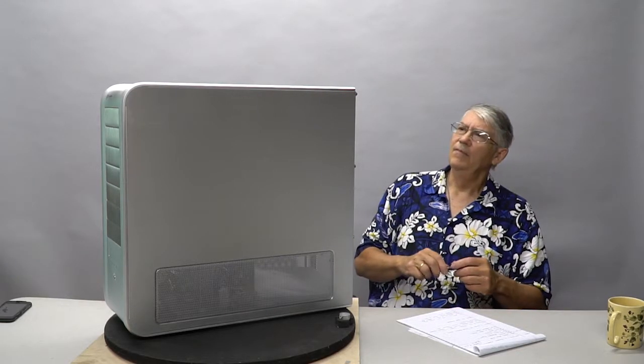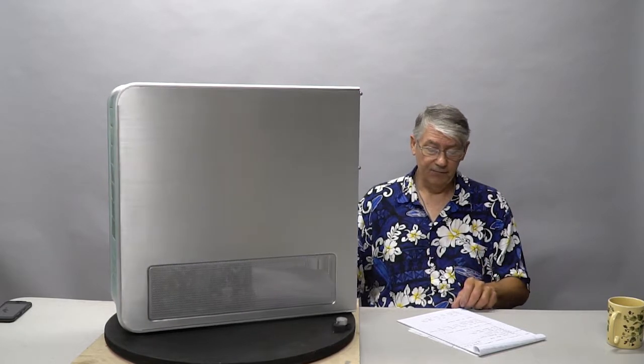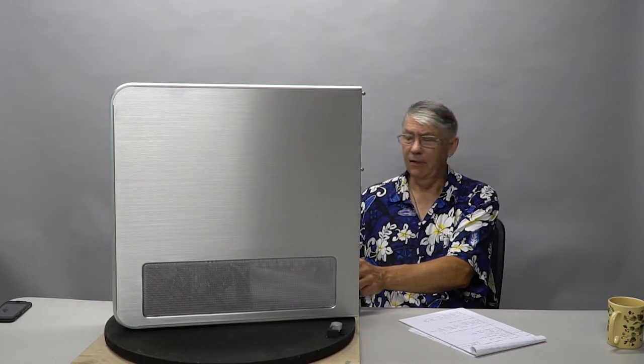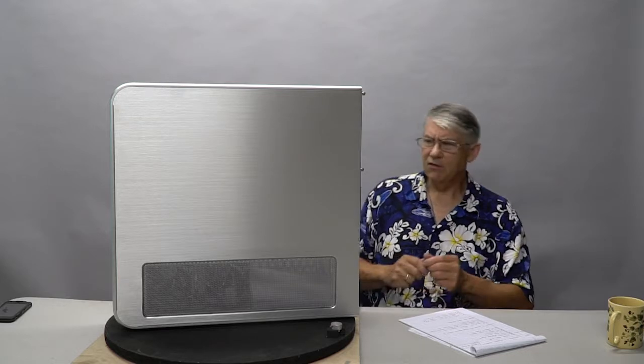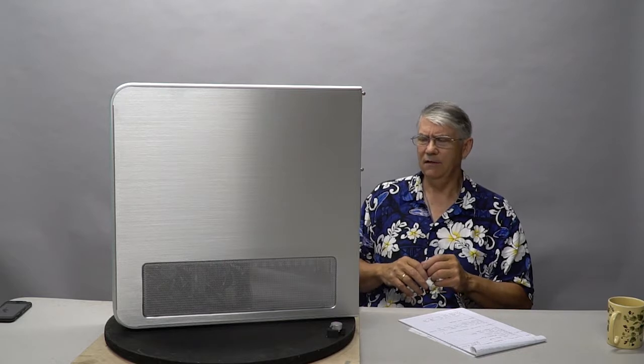And I'm here to talk to you a little bit about this case we're going to use for this build. This build is going to have, and I'll go over all the details of the parts later, but just in an overview, it's a 7940X, and we're going to overclock this thing pretty hard. We're running twin 1080 Ti's in an SLI configuration, a 480 millimeter Hardware Labs 60 millimeter thick radiator in the bottom of this thing, dual EK D5 pumps, PWM pumps in series. So this thing is going to be packed, along with a reservoir and a few different bay devices.